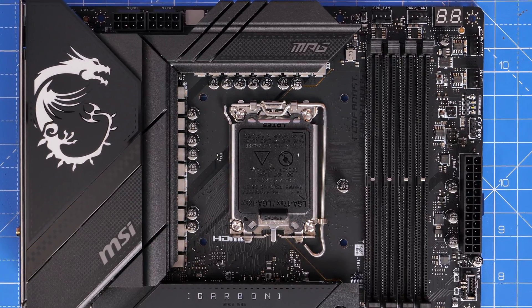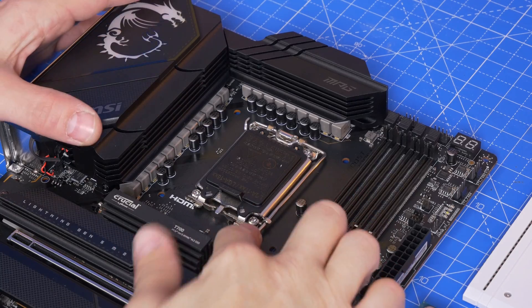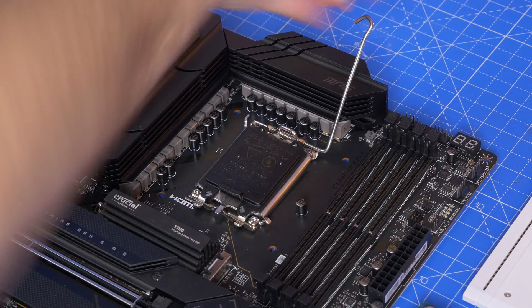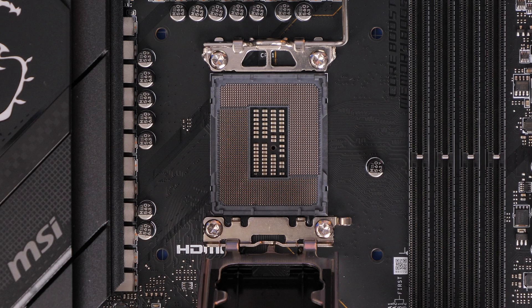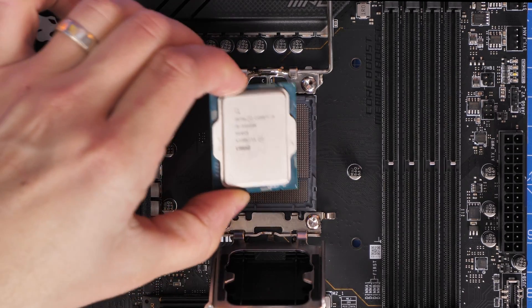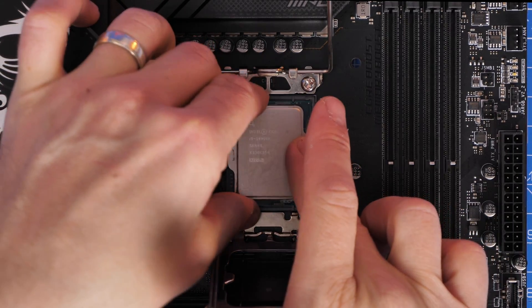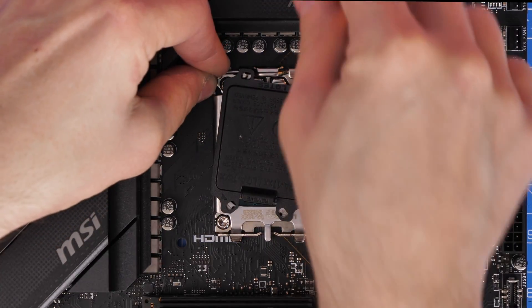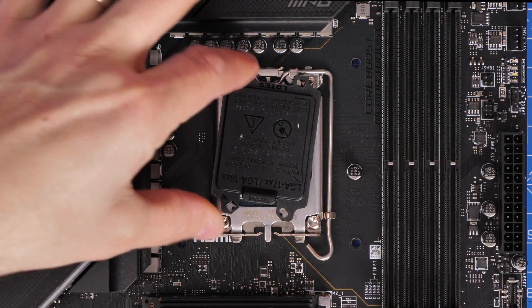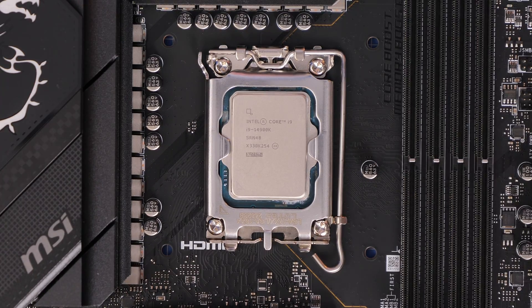A contact frame is an interesting replacement and a really easy upgrade to your system, because it essentially replaces the bracketing around the CPU which has been shown to cause some bend in the CPU over time. That mounting bracket puts pressure on the rectangular CPU, which can then bend it, meaning that over time it doesn't get as smooth a contact with your CPU cooler, which can result in hotter temperatures. So it's a worthy upgrade whether straight away or if you've been running a system already.